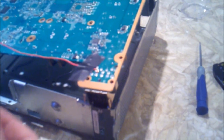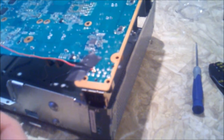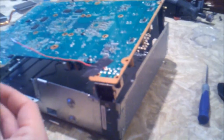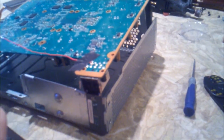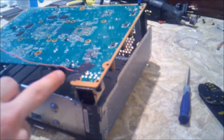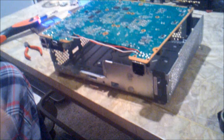disc tray, 12 volt power source there. That is a way to do it. However, it can stress out the disc tray, and if you cut it, splice it, add to it, you can short circuit the disc tray wire. That wire is actually fragile. Have I done it and completed it that way? Yes. This is a better power source though. It's straight from the power right here. You're not going through components or whatnot. So this is a better choice to make if you can do it. If you can solder, which isn't too difficult to do.